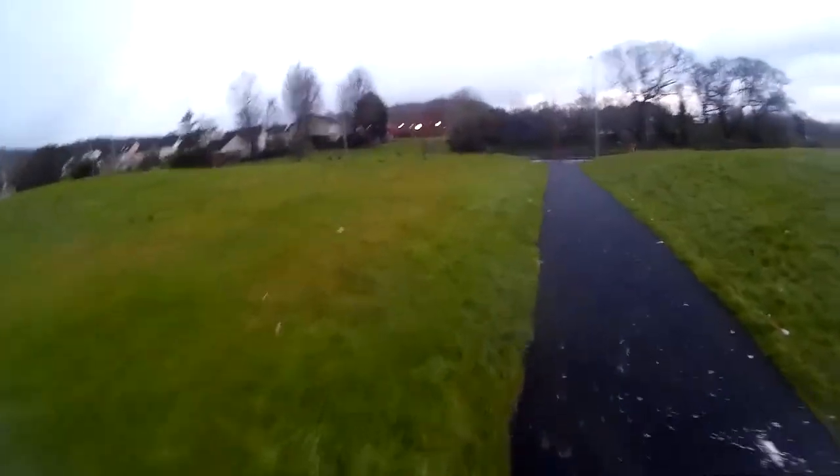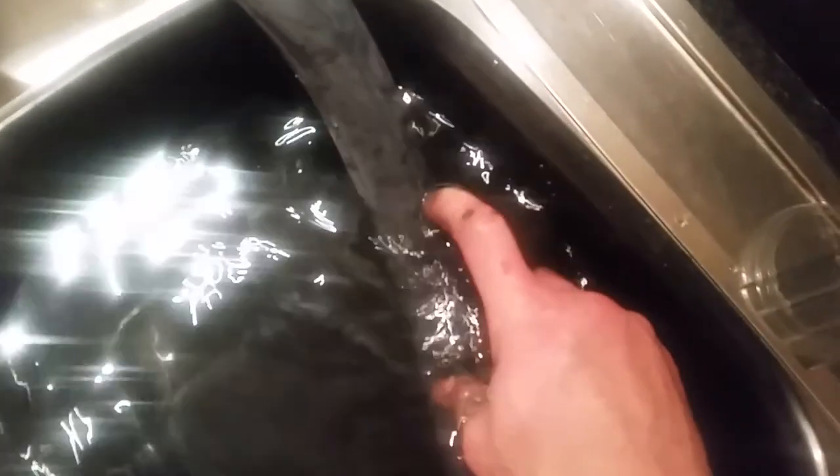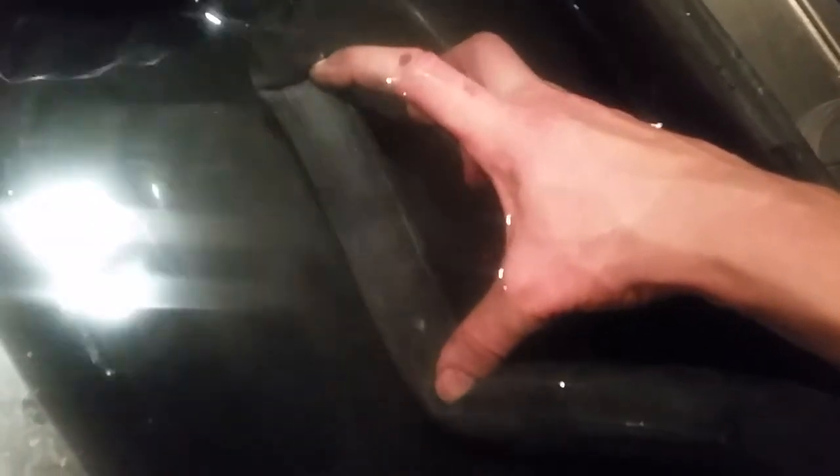So I got a slow puncture in a second. Not too sure if you're familiar with the water test — I've already done this so I know roughly where it is. I've got the old water out, just looking for bubbles. Yep, there are bubbles coming just below my thumb there — can you see that? Have a look and see. Yep, you see that?